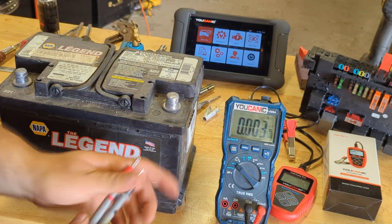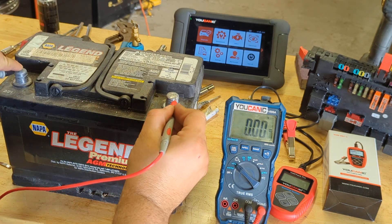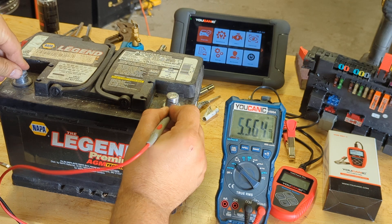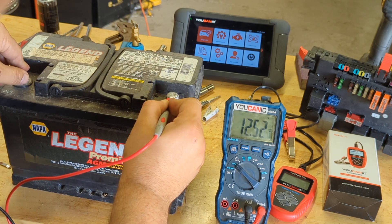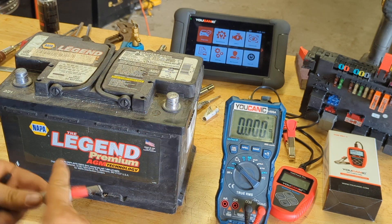So I'm going to show you exactly. Here we have a car battery — connecting negative on the negative and positive over here — and we're reading 12.5. Technically, it's pretty good, it's a charged battery. And you think, okay, this is a good battery. Most people would. A lot of tutorials out there tell you that this is a good battery.